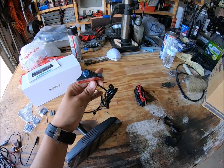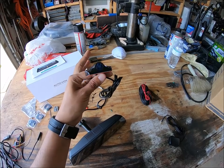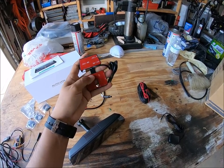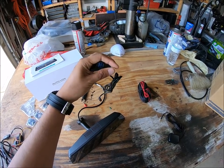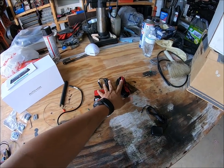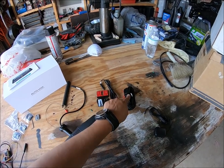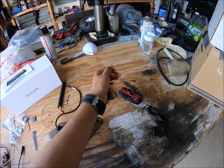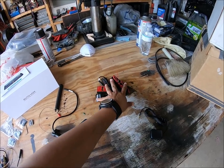So while you're driving, you're recording reverse and you're recording in the front. So if you get rear-ended, you'll be able to know if the person was paying attention or not. It's nice that they give you multiple bracket options — you can put this behind the license plate, or put it on top of something and nestle the camera hidden away. And this over here is the power supply for this unit. This is going to plug in directly to that, and then this is going to tap into the signal wire or your reverse signal source. So those two go hand in hand.